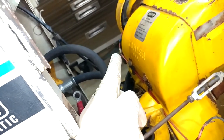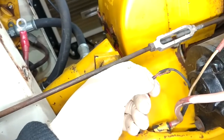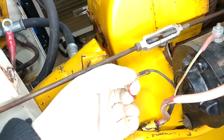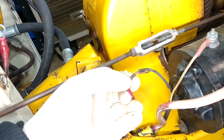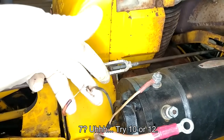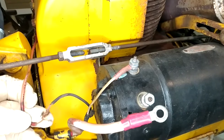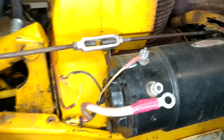I cut it off and found a splice to the original harness that goes over to the points — and the repair over there is one I made about 10 years ago, shrink-tubed and soldered. But this connection has been twisted together with nothing holding it there for the last 30 years as far as I know. You can see this cable starting to burn right there, and it's broken many strands because there's a stress riser. Those are the only remaining strands of wire doing anything — maybe six or eight individual strands of copper. So I've got some nice seven gauge we'll tie into this to get plenty of power over to our coil. Good grief — stuff like this is why I really ought to just replace the whole harness.